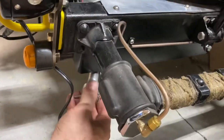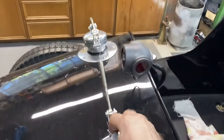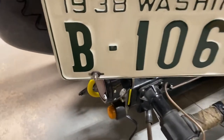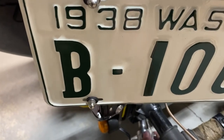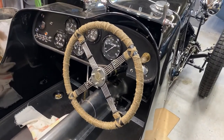These are the securing nuts for this — it hinges down just like that, and you wind these up in order to check fuel. This particular car doesn't have a sending unit, so we've got a dipstick. The way it works is you dip the tank and there will be notches on the stick for each gallon of fuel — that will be calibrated so I know how much is in there. It's not a bad system; it seems kind of archaic, but 12 gallons gets you a long way in this car. If you run out, you've got three gallons on the other half of the horseshoe tank as a reserve, so you can flip over to the other fuel pump and if you drive easy you could probably get another 60 to 70 miles — plenty of time to reach a fill-up station.